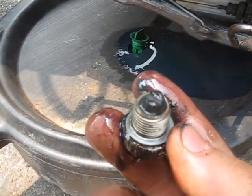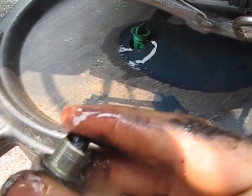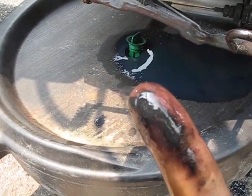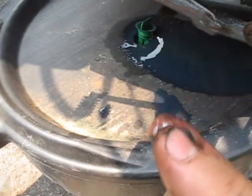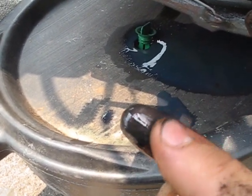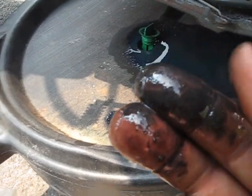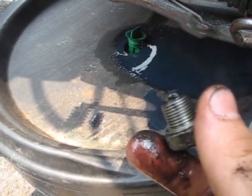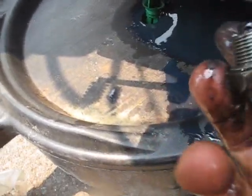Also, take a look at the bottom of your drain plug. Most of these are going to have a little magnet attached right there. You can scrape with your finger and take a look at what's underneath. This magnet is going to catch tiny little metal flakes that are in suspension in your oil. Right now I've got just a sheen — not even metal flakes, more like really, really fine dust mixed with the oil. That's to be expected on a 1985 bike with 42,000 miles. That's actually a really good sign of very minimal wear, and I'm very pleased with that.